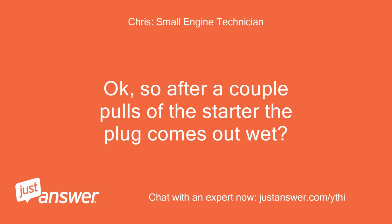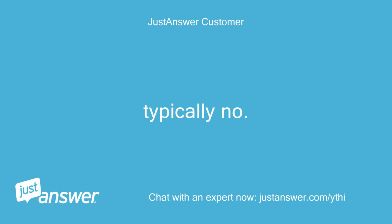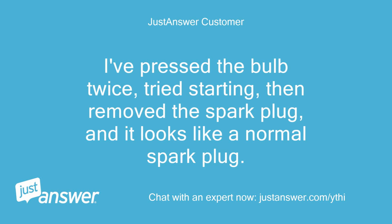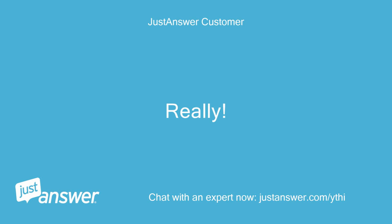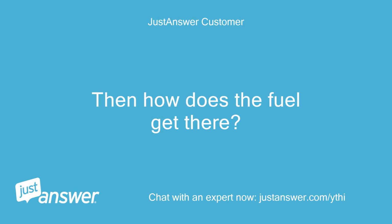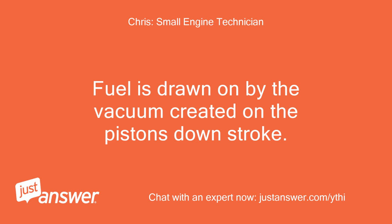Okay, so after a couple pulls of the starter the plug comes out wet? Typically no. I've pressed the bulb twice, tried starting, then removed the spark plug, and it looks like a normal spark plug. The primer bulb does not shoot fuel into the carb or intake of the carb, it only removes air from the fuel system. Really? Then how does the fuel get there? Fuel is drawn in by the vacuum created on the piston's downstroke.